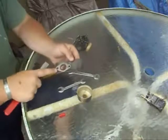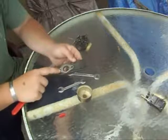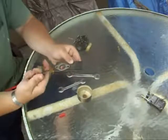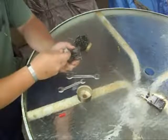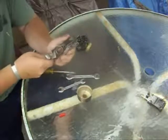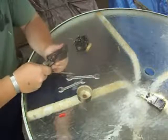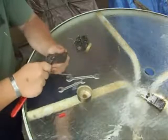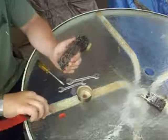I'm going to rough the surface up with some very fine sandpaper, just to clean off the rest of it so it gets a good seal with the new gasket material — take a very fine emery cloth just to scrape off what you can't get with the scraper. On the back here it's the same deal, just work it off with the scraper. Got to be careful because the tool can slip and get you right in the finger, which does hurt.